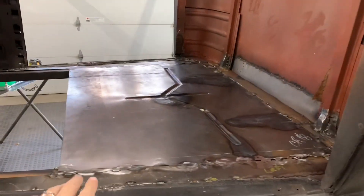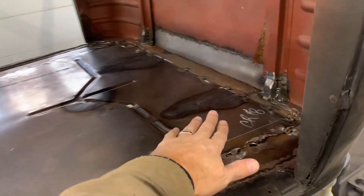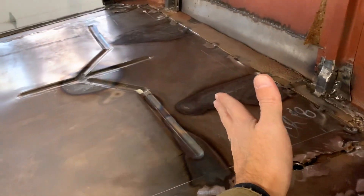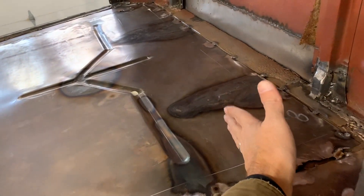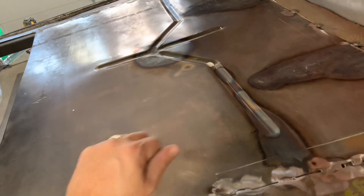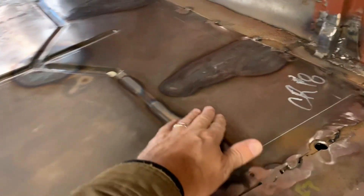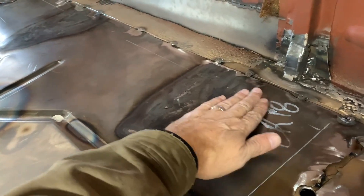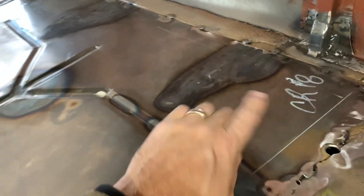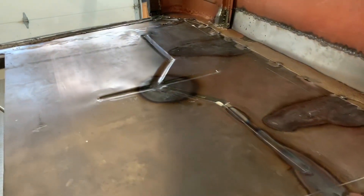Continuing on the floor - I now have it welded. I had to do a lot of heat shrinking here because the material was wavy through here. The floor is not exactly perfect, but when I put the seat bottom on there it'll go from here to here, and that channel will help draw that floor a lot more flat - there's just a little wave right through here. I can also do some more hammer and dolly work. These were my bad spots right through here - this was humped way up on both sides. I just knocked that down and it's got a little ripples in it but it's pretty good. I can continue working on that later. That is the floor bottom, and a seat riser will go on that floor.